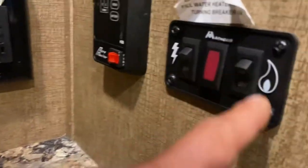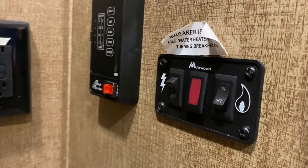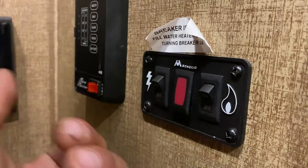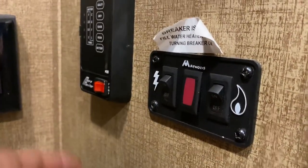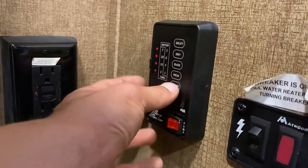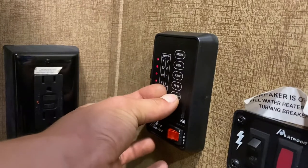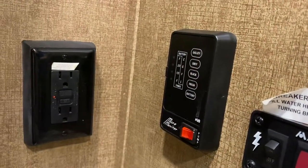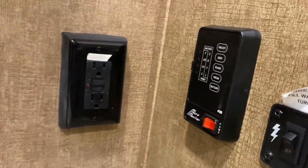We're in the bathroom here. The light switch is just on your right. Beside that we've got your hot water tank controls — on the right, the flame icon is your hot water turning on with propane. Turn that switch on and it'll fire up the propane. If the red light in the center comes on, it just means it hasn't fired up, so just turn it off and back on to reset it. On the left side you've got electricity to turn it on with hydro. Then your monitor panel: in the bottom corners, your pump switch turns on your water pump to draw out of the fresh water tank and pressurize your lines. We've got batteries — currently showing C for charging since we're plugged in. G is good, F is fair, L is low. For your fresh tank, as you fill it up it'll go to a third, two thirds, and full. Same for your black, gray, and galley tanks. Galley is your back bathroom, gray is your kitchen sink, bathroom sink, and shower, and black is your toilet. GFI-protected outlet back here — Test on the bottom, Reset on top. Medicine cabinet, hot and cold water at the sink, and a little bit of storage below, being mindful of the drains and water lines.